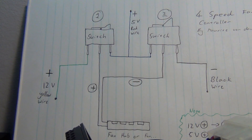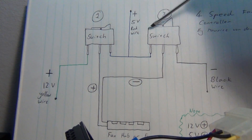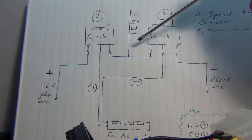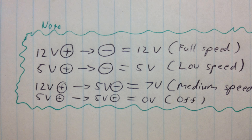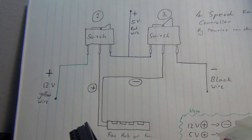So I will make a vague attempt at explaining how this setup works. You have got two switches, each with three ports, and for your fans you will have four settings: full speed which is 12 volts, medium speed which is 7 volts, low speed which is 5 volts, and you can also turn them completely off.